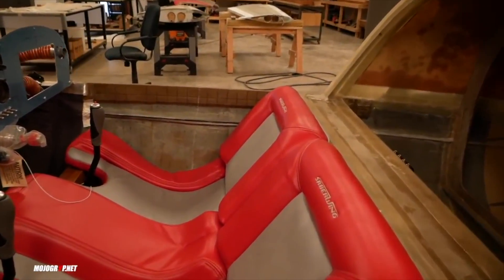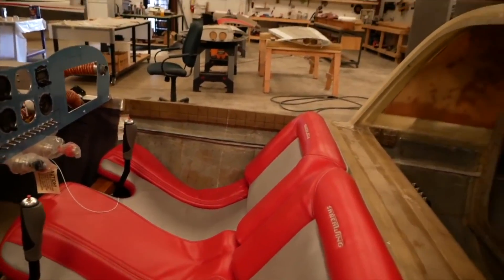We are also starting on a motor glider version. In order to do the motor glider version, you have to have a featherable propeller, so we're actually designing that right now with this engine. The turbocharger will also help with the motor glider version. At the same time, we're developing what we call the XF — which stands for extra fast — incorporating the 160 horsepower engines, a shorter wingspan, a little lower profile on the turtle deck and canopy, and with the option of retracts.